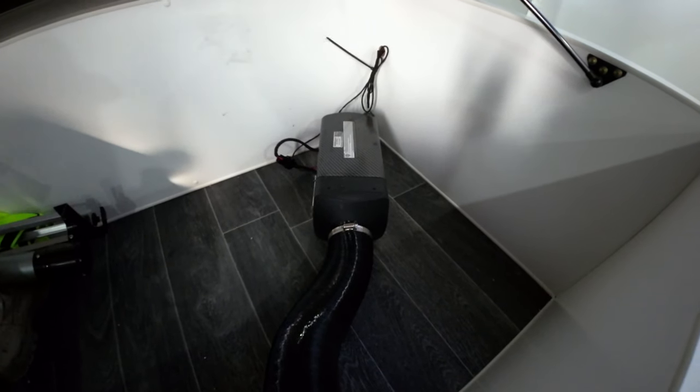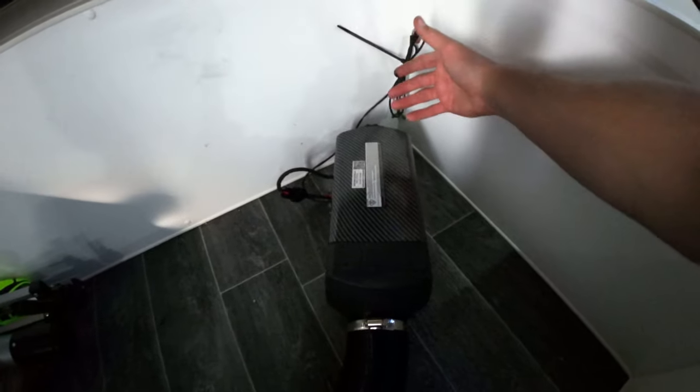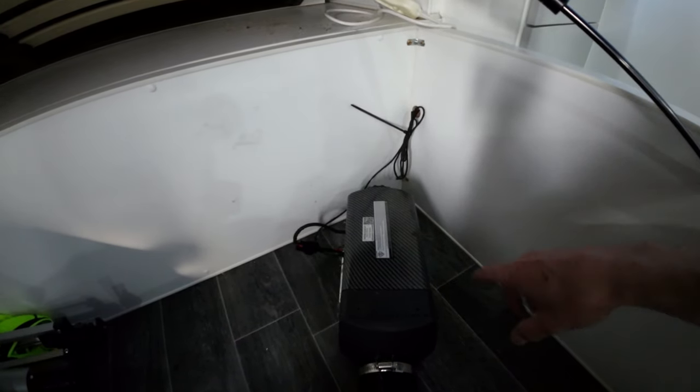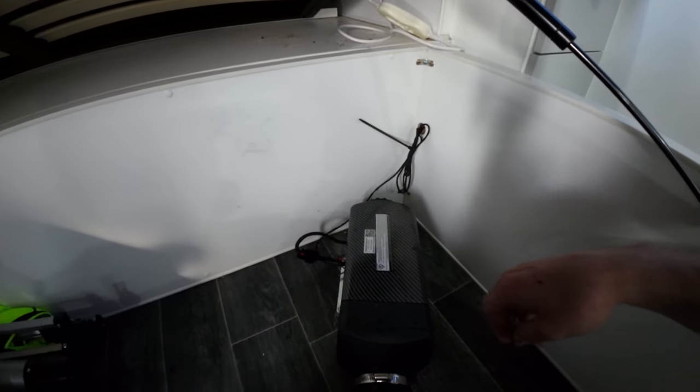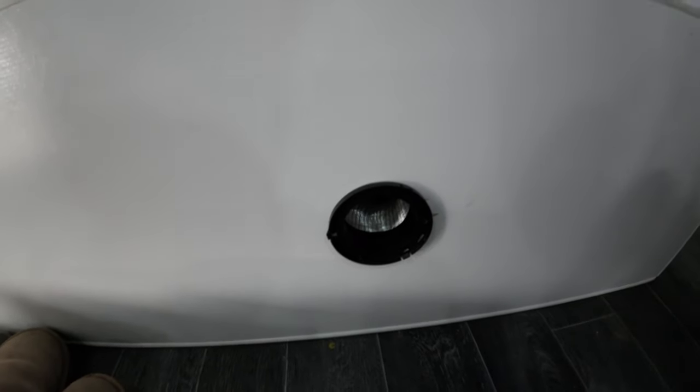So this is it installed — the diesel heater. Just a quick recap. It ended up going in the corner at a bit of an angle to give better back suction and more room to draw air. There's quite a bit of airflow between the mattress and the bed anyway, so it's not going to struggle there. I was going to drill a hole and make a vent but I don't think it needs it. Make sure you connect everything to the bottom of the main unit first before you stick it down through that hole — otherwise it's a nightmare.